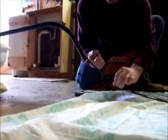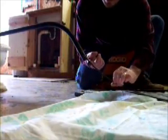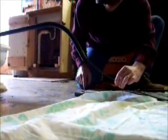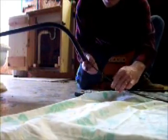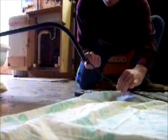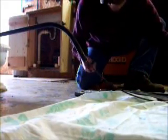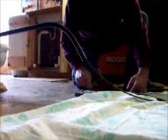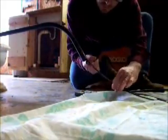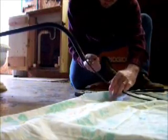So take that grease on your finger and kind of spin it as you're pushing that drive shaft back in there. It gets it in all them little grooves. Don't be afraid to lay the grease to it, like I said, but you just don't want a whole ton of it on there.